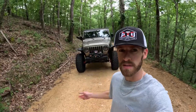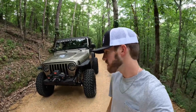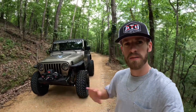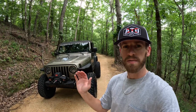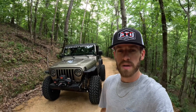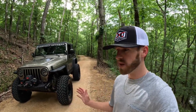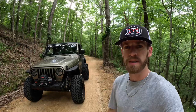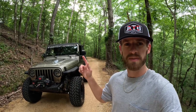As you can tell from how long it took me to post this second video to our Axle Swap Series, we ran into some issues. Number one: we got the control arms in, got the axle bolted in fairly loosely, went to hook up the track bar, and realized the stock track bar wasn't going to cut it. The Fusion came with a set angle for the track bar bracket. On a factory axle for a TJ, you've got to do a track bar relocation bracket when you do a lift, but Fusion welds on theirs with the correct angle — so you have no adjustability there, and with the stock track bar having no adjustability either, we were actually getting into a bit of a bind.